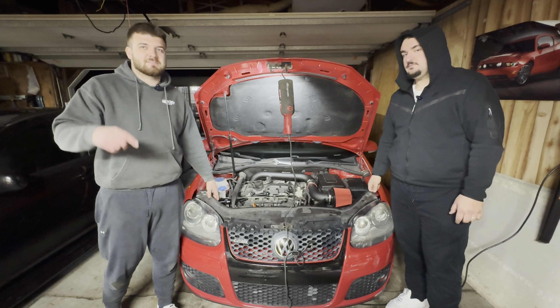This concludes the two-part series on installing an intake, a diverter valve, and an oil catch can onto this Mark V GTI. This thing sounds better and it's going to be performing better as long as the maintenance is kept up with the catch can. You do have to dump this — that's what the dipstick is for. Once it gets to the line, you need to dump it out — unscrew it from the bottom and dump it. You're supposed to recycle it. From personal experience, in the wintertime when it starts getting really cold, start dumping it out more often. In the winter, definitely keep an eye on that dipstick at least once a week, because it will fill up with a lot of sludge especially in the wintertime. Thank you guys for watching — hit the like button, hit the subscribe button, leave a comment, and we'll see you in the next video.